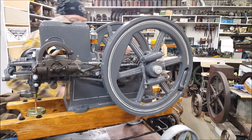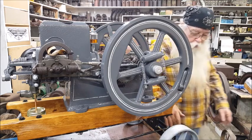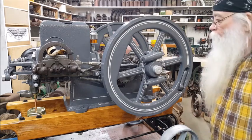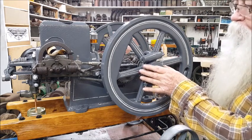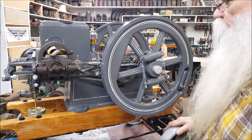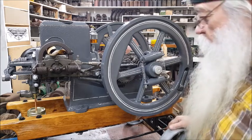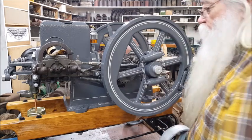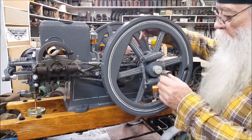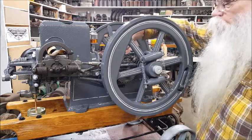Other than rust. It's finished — I think all the parts are here except the springs on the governor. And that'll be sorted out as the engine runs, to determine what the tension should be — which will be very light tension so as to disengage the push rod there.